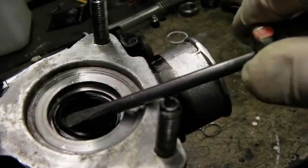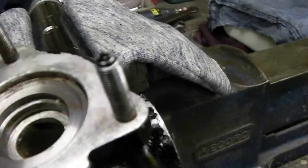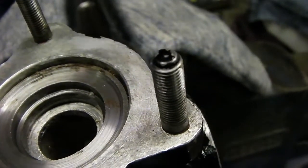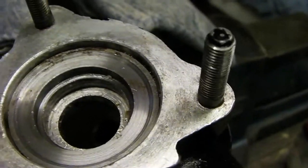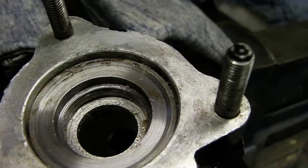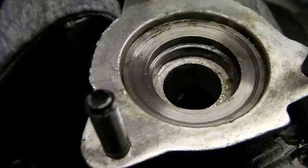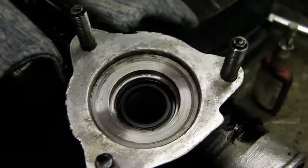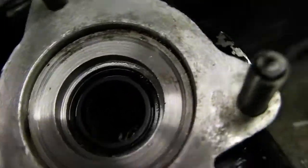This is the seal on the bottom of the tower — you get your screw and just peel the thing out. The seal has a lip which goes into a slot, so make sure that slot is fully cleaned out before you push the next seal in. These are quite soft seals and they don't have any reinforcement around their edges like a coil spring, so they will fit into these holes quite easily. This is the final critical seal — the bottom of the tower seal — which stops hydraulic fluid leaking into the rack's worm gears or out of the top through the pinion. I tend to put these seals in with just a touch of hydraulic fluid on them, as these power steering systems run on gearbox hydraulic fluid — it just helps settle the seal into the slot.